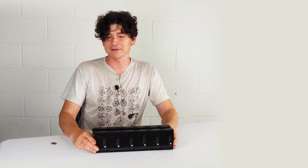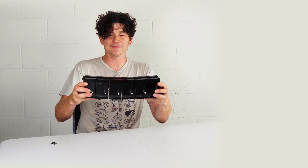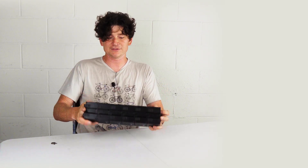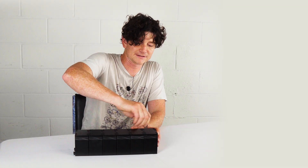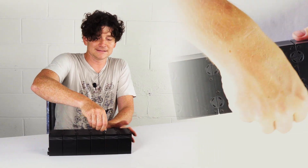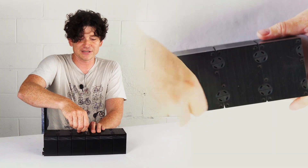Those latches mechanically hold them together and connect them electronically. But you don't want to stop just at that, because even though they're held together they're not very stable and secure. It's imperative that you also flip the assembled LIGOs over and twist together the twist locks that are on the underside. This then increases the stability to have four points of secure engagement between each adjacent pair.